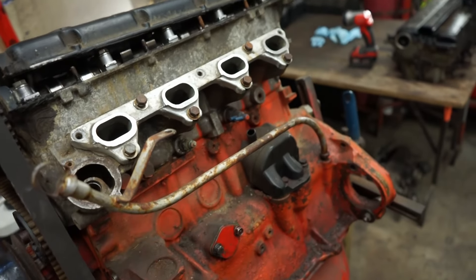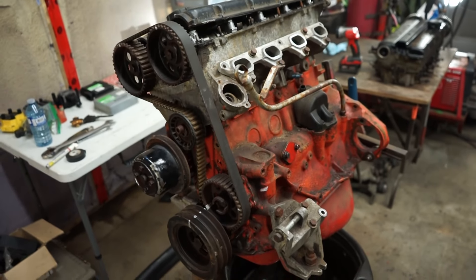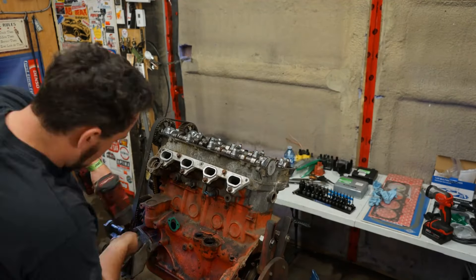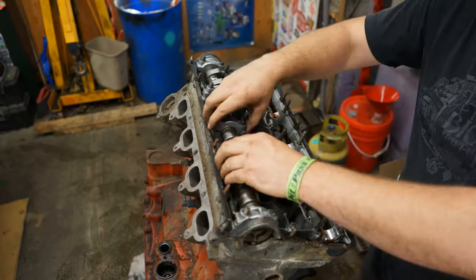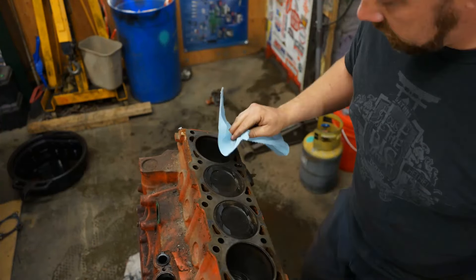The tensioner setup is the Penta tensioner, so that's already figured out for me. Then there's notching the pistons - when you put this head on a red block the valves need a relief pocket cut on top of the pistons - but this being a factory 16-valve should already have those done. Just tear it apart and see what we're working with.